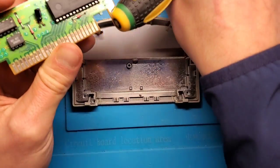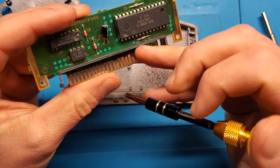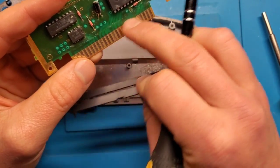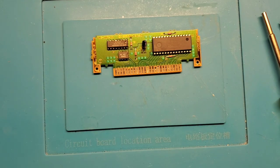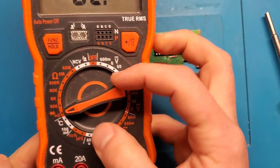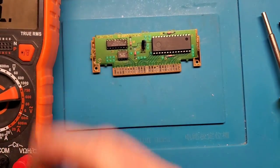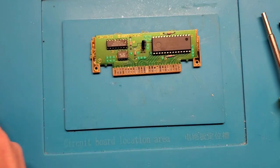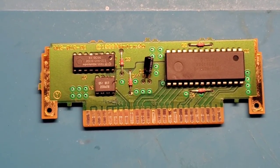See right along here — there's this line, and that's where that black spacer was sitting. A lot of times what I see, especially with N64 carts, is the spacer sits just like this. It's a pretty tight fit, there's a little bit of a gap but not much. If this ever gets humid or moist, if there's condensation, it will sit there, it won't evaporate very well, it'll leave residue, or it'll start rubbing and can actually damage those traces. That's a very common spot for failure. So before I go too far, I want to test out these traces. I'm going to grab my multimeter, set it to the continuity setting — usually it'll have a diode icon or a speaker icon — and whenever it tests a complete circuit with no resistance, you get a beep.